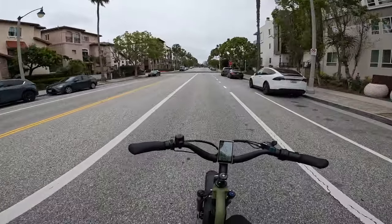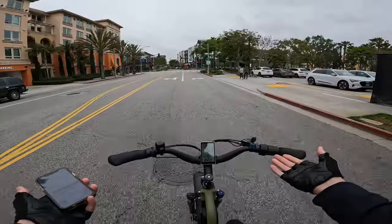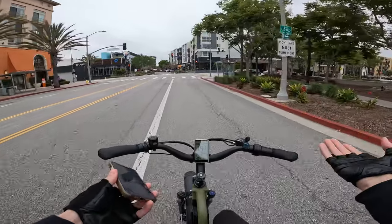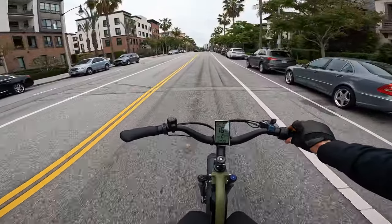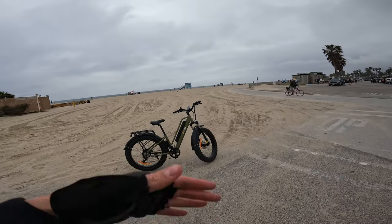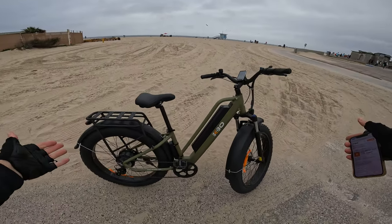According to the voltage chart, a 48-volt battery at 45.3 volts is about 40% — and the energy bar does indicate about 40%. So if you put a little pedaling in, you could probably do 45 miles on this bike no problem. The way I ride, I'd probably get 35–40 miles. Throttle only, probably more like 25 to 30 miles. The battery is feeling a little weak right now. If this isn't the bike you're looking for, check out the next video. Thanks for watching — give me a thumbs up, drop a comment, catch you next time.